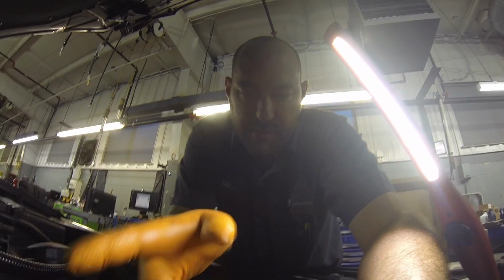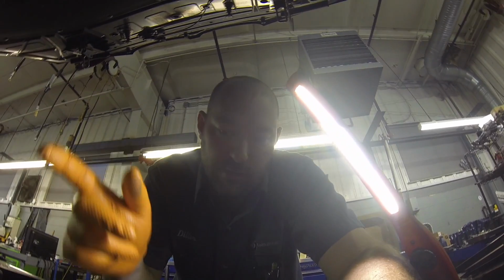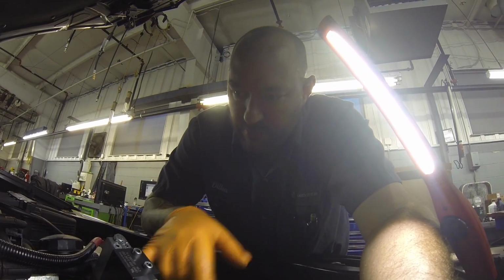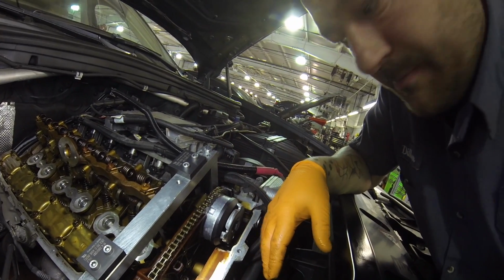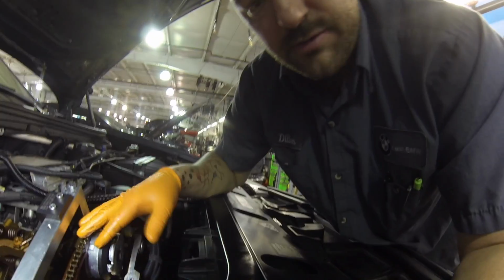So you lock the cams, the crankshaft is pinned at the flywheel. A pin tool goes into the flywheel and locks the crankshaft. That's how you set your timing. Camshafts are then timed. The Vanos gears are not splined or anything to the camshaft. It's just an interference fit. So it doesn't matter where the chain or the cam gears are at.